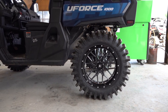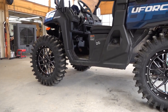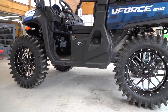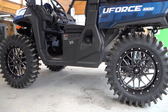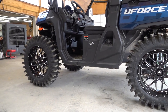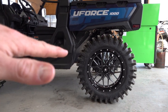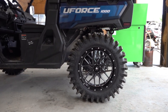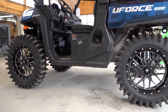It also makes it where you can clear up to a 35. We're going to show you footage with all-terrain tires, but some of you may not want that setup — you might want just 32s or 30s, which will look great too. You get the rear rake, the high clearance, better suspension geometry, and A-arms where you can adjust the camber with heavy duty construction that's going to last forever.